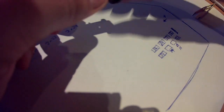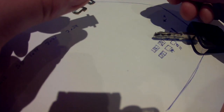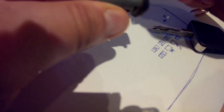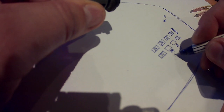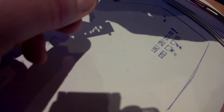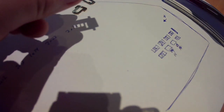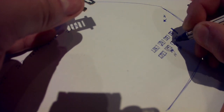After more testing, 14 looks pretty nice in the third slot and 13 fits well in slot two. That moves very smoothly — just a tad up, but we had the same issue with 13 there too, so that's probably just wear on the key. I think we have a solution. The bottom row is: slot 1 = 22, slot 2 = 13, slot 3 = 14, slot 4 = 24. The 12 vs 14 asymmetry between top and bottom is probably because of the valet key.